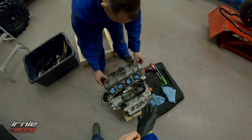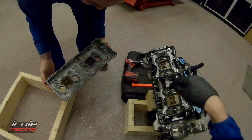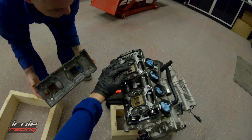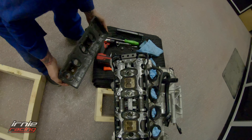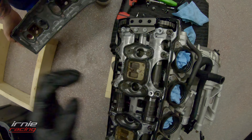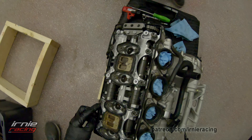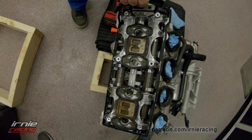It slots onto the shape of the spark plugs so you get a nice hold on them, otherwise you're grabbing them with pliers and damaging the plastic. It's just a nice tool to have when you change a lot of spark plugs. Now look at that — it's the exhaust, and you can see how the system recirculates air from the left to the right and then to the air box — it's all about emissions. Normally you'd just block these off; apparently having them blocked makes dyno tuning easier since there's less variance in fuel tuning. Anyway, cylinders one, two, three, four — next step is pulling the cams to access the head bolts.